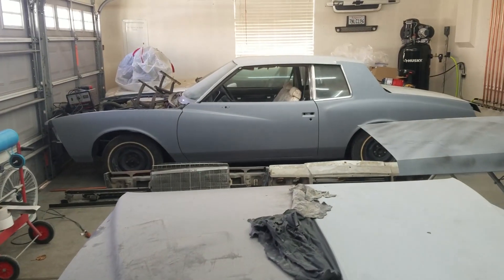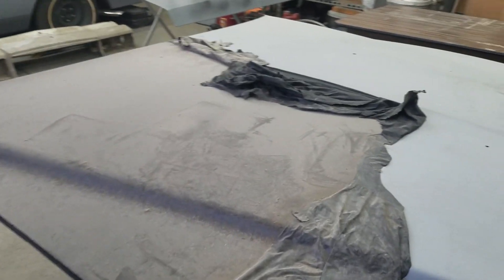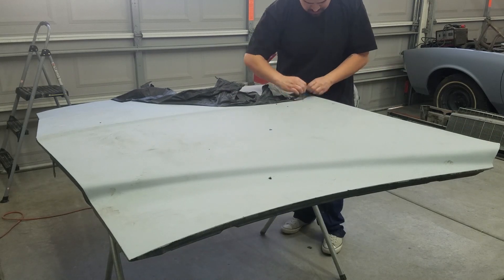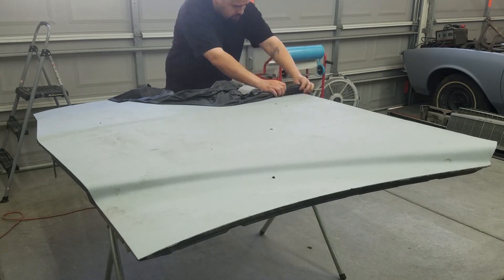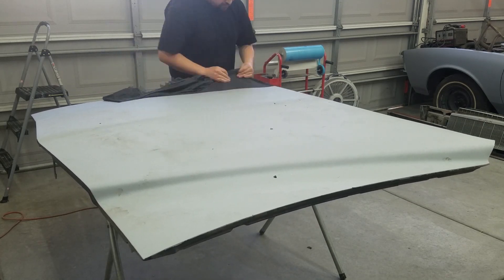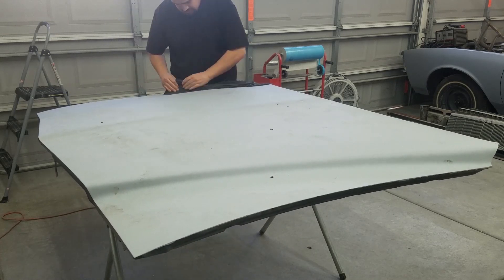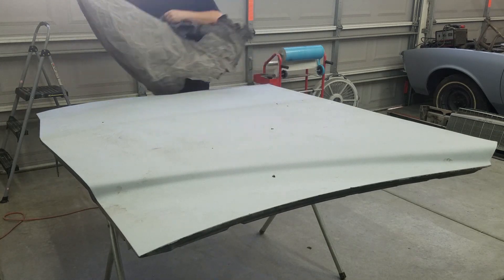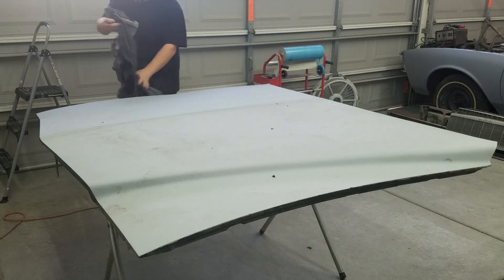Now I can start working on the car again. Now that the hood's off, I'm starting to take off the plastidip. I really want to get this car done, or at least painted, so I want to keep this moving. It's done — took it off. Looks like the plastic wasn't a bad idea, actually, because it looked like it protected the primer. I still have to sand it with some 80 grit, take that off, clean it up, block it, see if I find any dents, and keep it going.